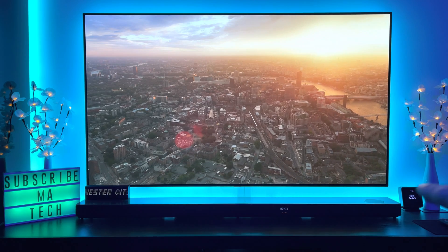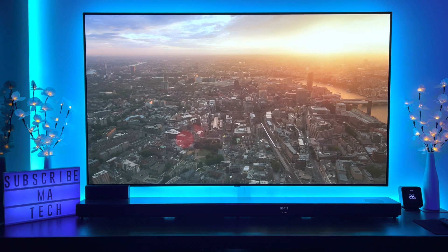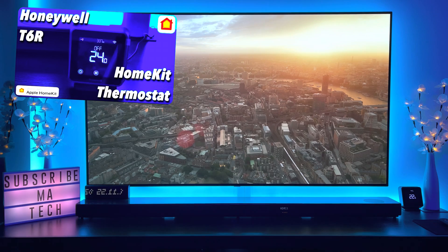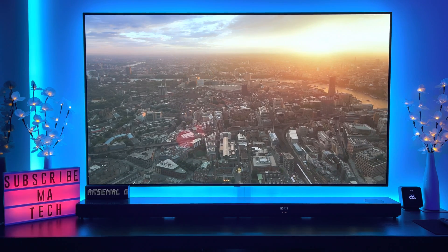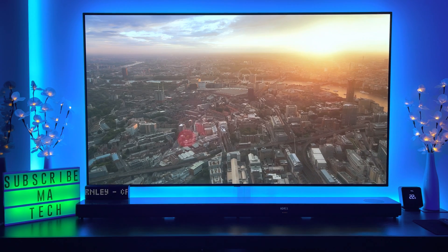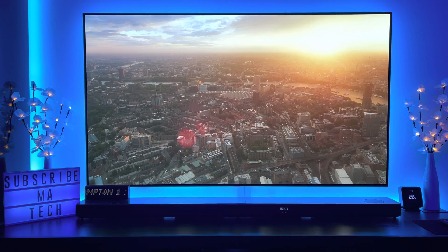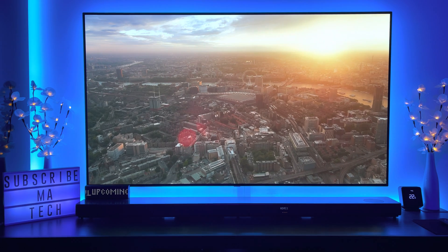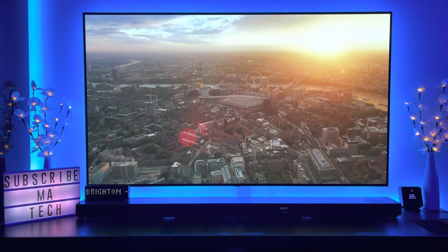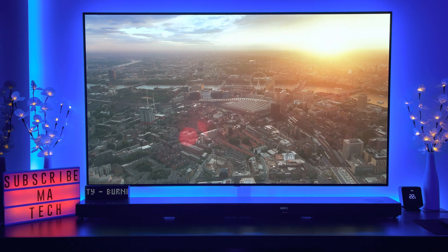I was actually having issues with the thermostat in the bottom right of the picture. I made a video on that particular device — it'll be linked on the channel under the HomeKit playlist. In that video I commented that that device simply works and never has a problem, which is why I love it. But recently since updating to 14.2, sometimes the scenes would work — if I set it to 22.5 it'd click on — but other times it would just give me 'no response' until I moved around the house and connected to a different Wi-Fi repeater. I have the Orbi system, so I first thought it was related to that. It wasn't until I went into home settings and realized all three of my home hubs were showing as standby.